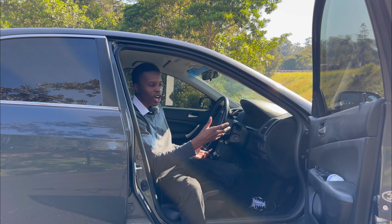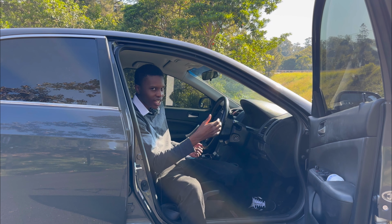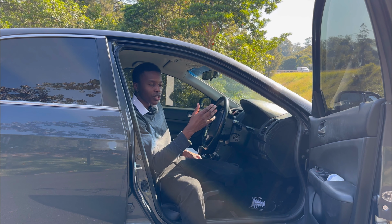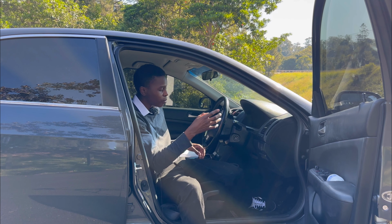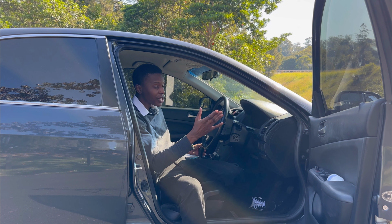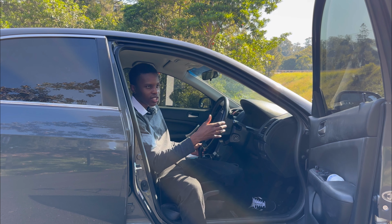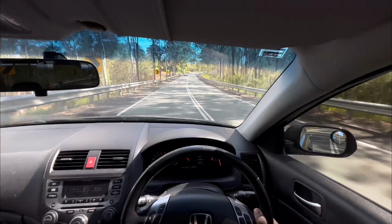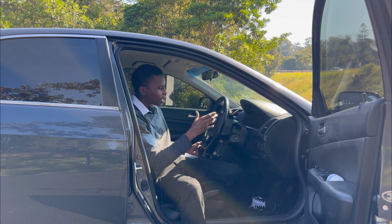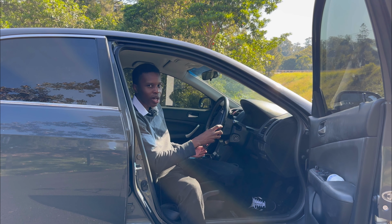So the final drive on this vehicle is so much shorter, and it really helps with first and second, because I know the second on the standard Euro gearbox is terrible. Ask me how I know, it's terrible. You put your foot down, you shift into second, and you're completely out of VTEC. Whereas on here, you pretty much stay in VTEC when you shift into second. The LSD as well on this vehicle really wakes it up. It really helps with the cornering, it really helps turning and putting the power down. It really helps the power delivery.